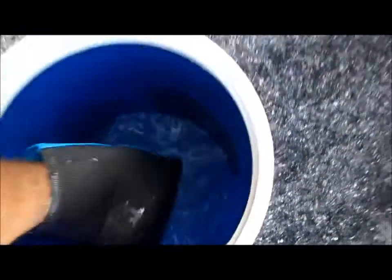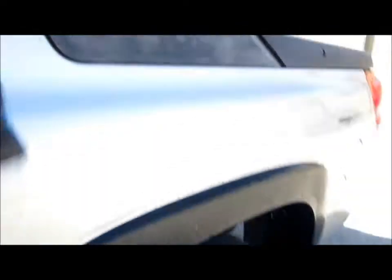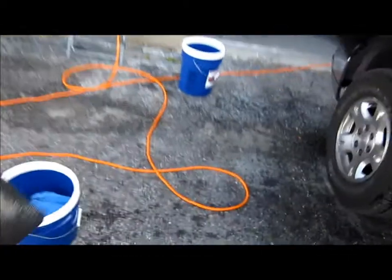After you get done with a panel, I recommend just wringing it out. Go back over the surface just to re-lubricate, then flip it around and just glide it across the surface. I can feel all the contaminants that are there. If I can feel contaminants that are pretty heavy, I'm not going to go much farther than a 2x2 section before I go back over to my bucket and wring it — get a lot of that dirt and grime off, at least clean the surface of this polymer off before I go back into it.